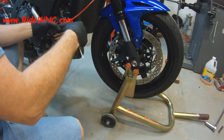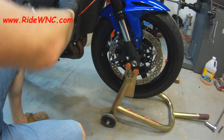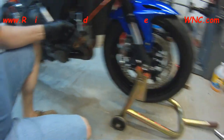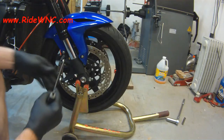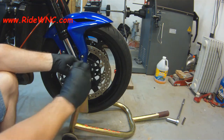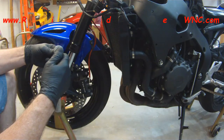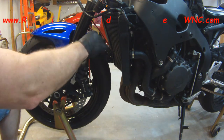With the zip tie — because the front of the bike has to come off — if I were just replacing the rear tire or the front tire, I probably wouldn't zip tie the calipers out of the way. But since I need to have these calipers out of the way when I pull the forks off and get that triple tree out of the way, I'm going to zip tie the caliper over by the radiator just to keep it out of my work area. And I'm loosening these screws on the fender just to make it a bit quicker later on when I pull this fender off.